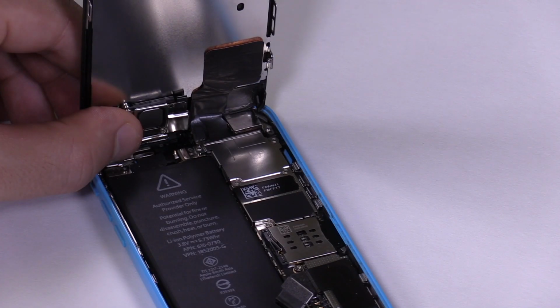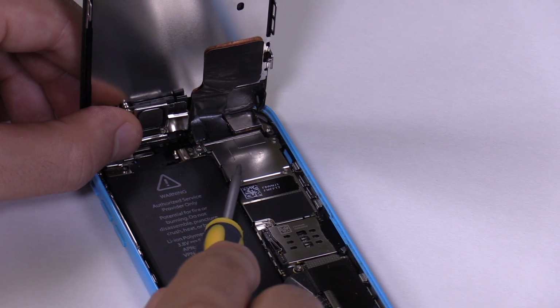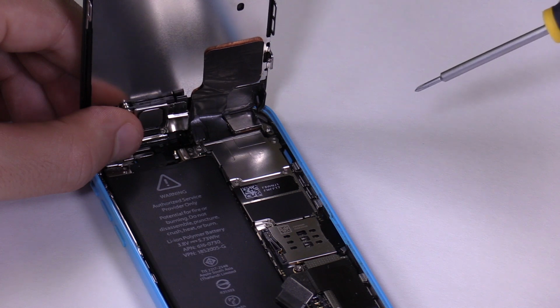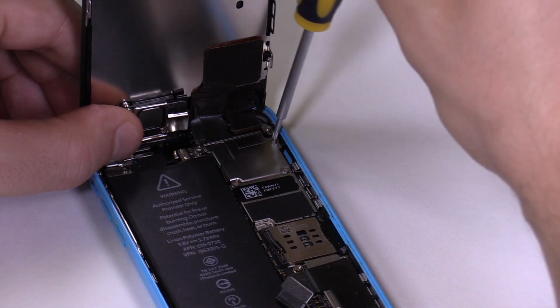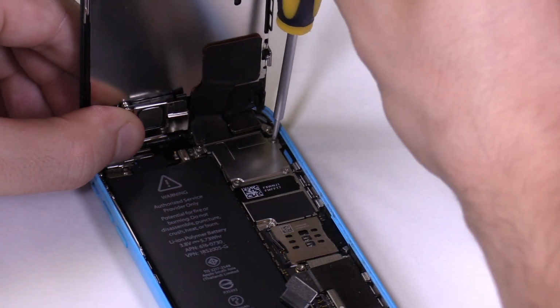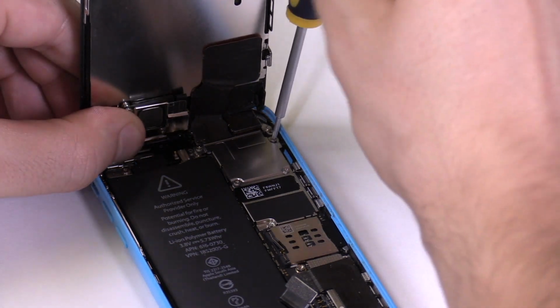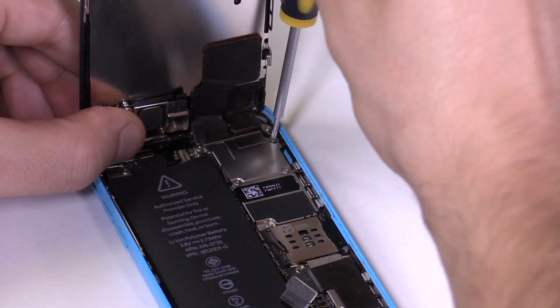We'll now move on to disconnecting the front screen's connectors. Begin by removing the metal shield. The top right screw is in most phones not magnetized, and you may need to assist with the tweezers to remove it. This screw is also longer than the other 3 screws holding the shield. It's crucial that this long screw is put back into the correct hole when reassembling the phone.